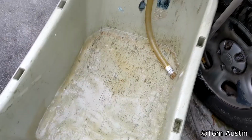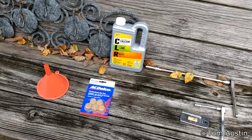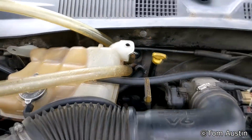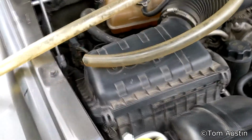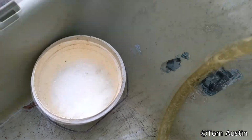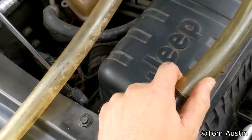And as you saw at the beginning of this, I didn't really have much crap in there, but that's because I've had my heater core disconnected for 2 years because I have a pinhole leak. And now what I've done is I've added about maybe a cup of CLR into the heater core just to fill it up after I blew all the water out with just what I could with my mouth. And I've let this sit for about 5 minutes. You can probably go to 10 or 15, but I don't want to accidentally make anything worse. This is just to remove any deposits, silicates and mineral deposits, because I put a lot of tap water in this, and the previous owner did not take care of this cooling system. And I've replaced everything in the cooling system except for the heater core and some of the hoses.